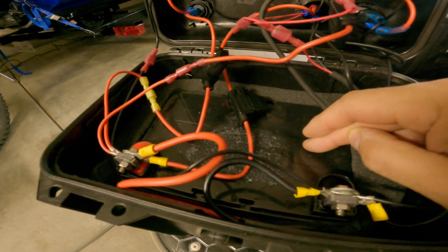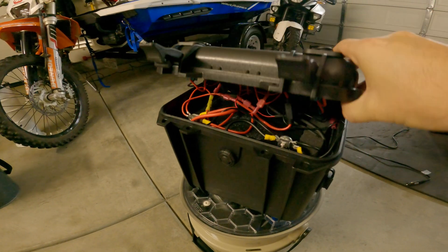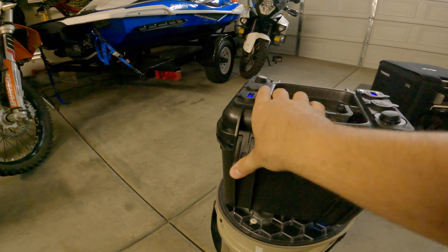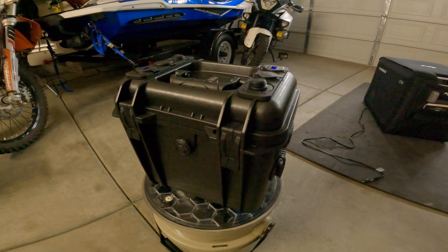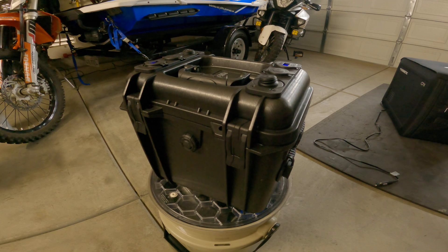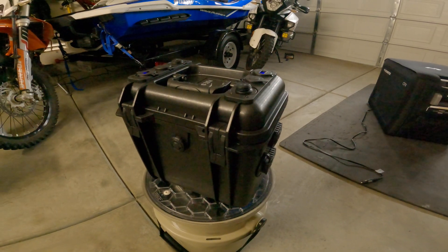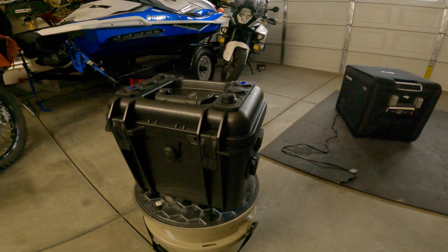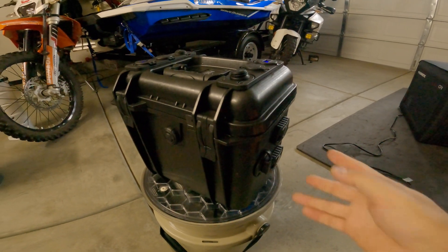This is the battery — it's a Max battery, 35 amp hour lead-acid. One option I'm going to do later is put a lithium ion battery in here, though those are really expensive. As you probably know, with lead-acid you don't want to discharge more than 50%, so a 35 amp hour battery gives you around 17 amp hours of usable energy — which is probably why the Dometic fridge lasted around 27 hours at 0.7 amp hours of usage.